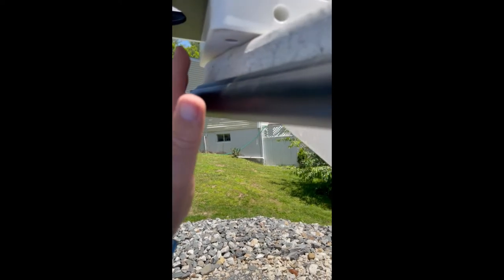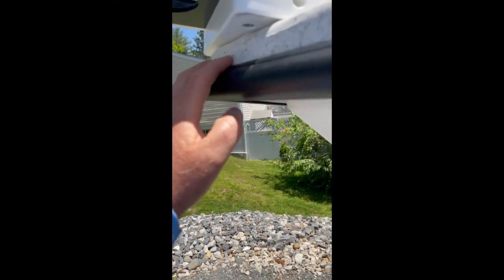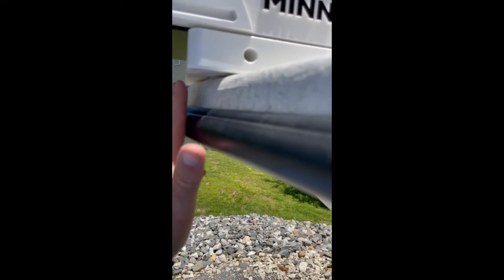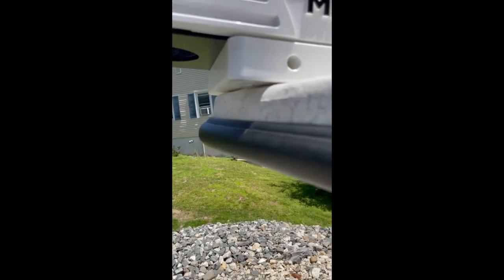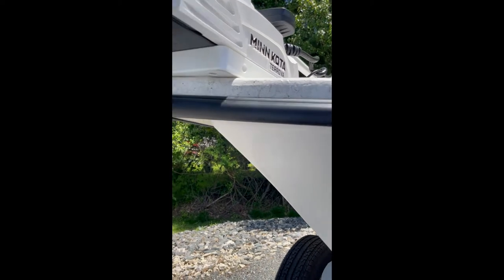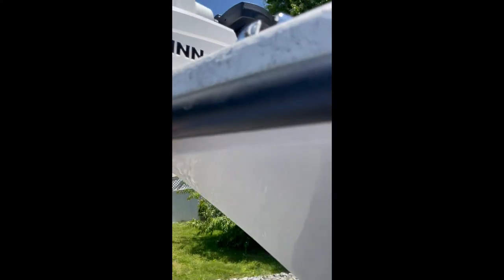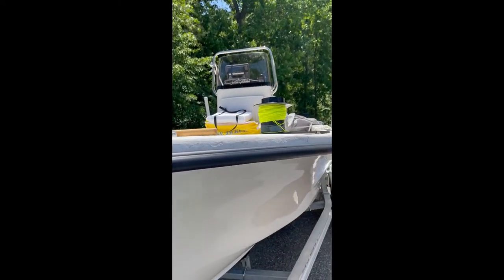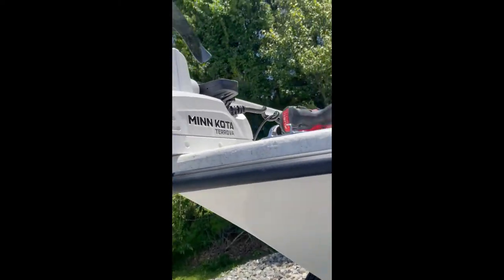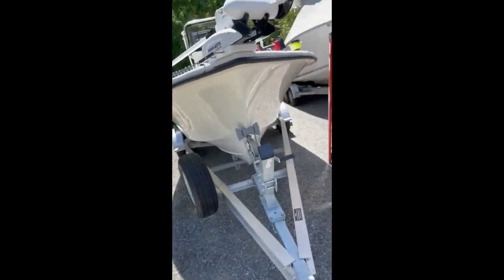In order to get the inch-and-a-half clearance you'd have to bump this out by an inch and a half off of here. But if I do that, the inner puck mounting holes end up off the boat — there's nothing you can do about that without making a subplate. I did see one guy who had his bolted up with the first two bolts. I looked at the various positions of where I wanted the motor to lay. I fly fish and I'm right-handed, so I typically fly fish off the port side, so I really didn't want the motor sitting off that side when stowed.